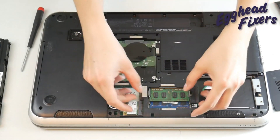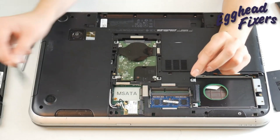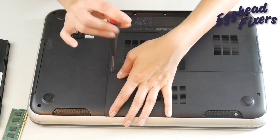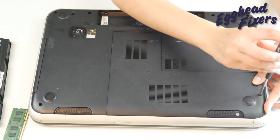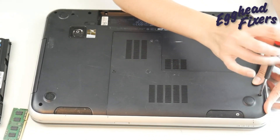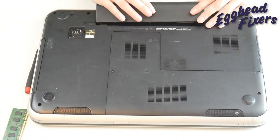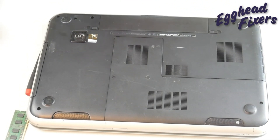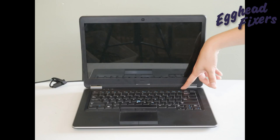RAM: you pull out on the side little arms and it kind of pops open, as you can see in this picture, and the little RAM stick will pop up. What we're going to do is take one stick of RAM out at a time, because RAM is like headlights on a car and they tend to go bad one at a time. So I take out one stick of RAM, leave one inside, then close the computer up and try to turn it back on. If the computer turns on with just one installed, then I know the stick that is outside is preventing my computer from displaying.